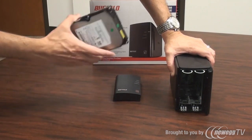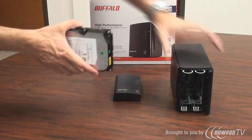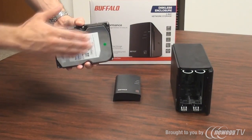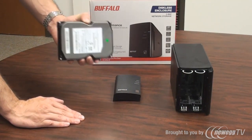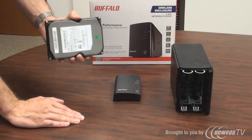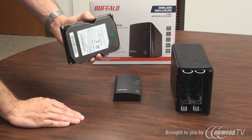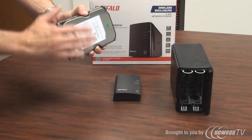In this case, I have a Samsung 3.5 inch SATA hard drive that I will install into this product. Now, it is very important that the hard drive you're installing has no existing partitions on it. The Buffalo LinkStation will not address a system with existing data or existing partitions on it, mostly for your protection. The device does not want to erase your data, so you will need to bring either a brand new device or an existing hard drive that has its partitions removed.